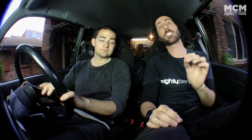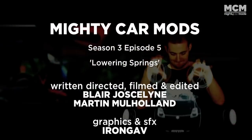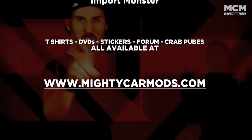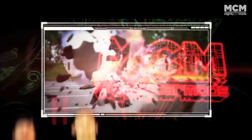So there you have it. It's a simple mod you can do in one afternoon — it makes your car look heaps better and a lot of the time makes it handle better too. Remember when you're lowering your car, it's actually changing your car's centre of balance and drastically affects how it handles. Make sure you check with a professional first and use equipment that's designed for your car. Don't heat your springs, don't cut your springs — it ends in tears. It's also a good idea to get a wheel alignment once you're done.